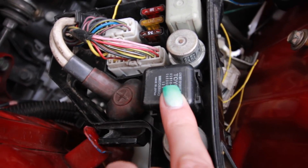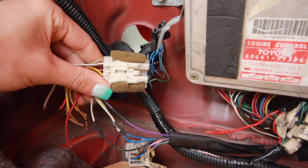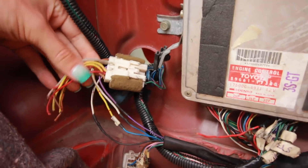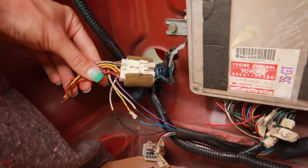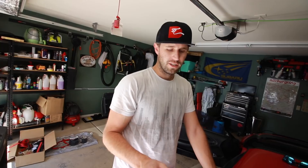This way it'll still draw its power from the circuit opening relay, so in case of an accident it'll still cut power to the fuel pump for safety. This right here is plug EA-1 — a hodgepodge of wires that was like this when I bought the car, because when you go from a JDM engine harness to a USDM body harness you pretty much have to repin and swap everything over. What we need to do is look for a green wire with a red stripe that is a ground for the circuit opening relay.